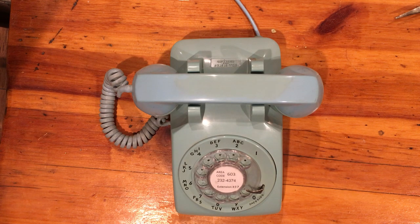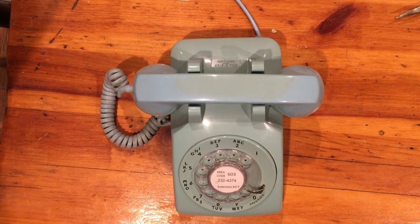Today I'm going to show you how to adjust the bias spring in one of these older phones so you get them to ring on more modern devices — VoIP services and stuff like that. Those devices typically don't put out the same kind of ringing voltage waveform and current that a traditional copper telephone line would.